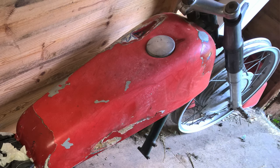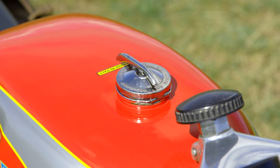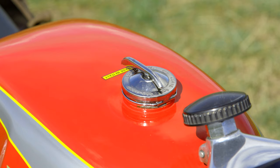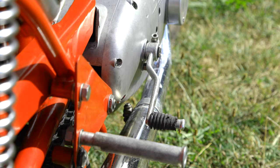The fibreglass was in a terrible state, and with modern ethanol-based fuels it's extremely difficult to make fibreglass petrol tanks watertight. So I found myself a Monza petrol tank. It's a narrow case engine, and even though it's a Mach 1, it's the same frame and same sort of running gear as most of the other bikes. The bits are fairly interchangeable, but I wanted it to look like a Mach 1 at the end of the day.